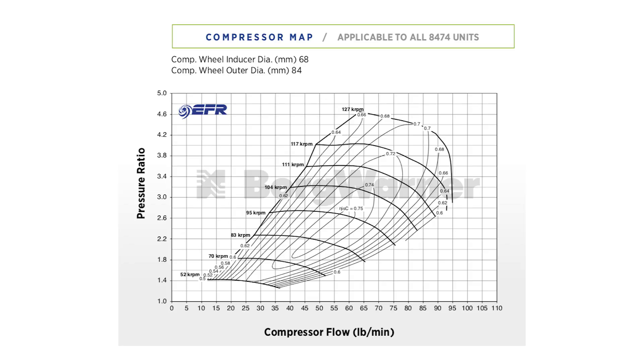First of all, turbocharger speed — is it relevant? Let me give you an example which might get those creative juices flowing and answer that question for you. Let's say, for example, you have a compressor map. I'm going to put the EFR 8474 Black Series onto your screen now. On screen you'll see the 8474 Black Series compressor map from Borg, and I want to go over a number of things.